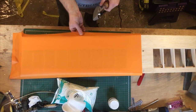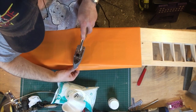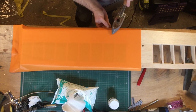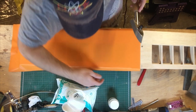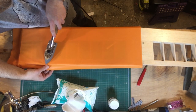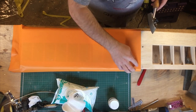So all I'm going to do now is come to the centre with a little bit of tension and tack it there. The reason we're doing the tacking is that if it isn't quite right you can actually take it off again without wasting the whole panel. And that one I'm just going to come all the way across — that's now quite well secured. Just move along, another tack, same other side, a little bit of tension, tack it in place. Half way along, quarter way along now — just another tack. And another tack at the trailing edge. I'm happy with that — what I'm going to do now is come across and tack this edge. Away where you've got the fully sheeted part underneath, I'm going to go over that whole area and make sure it's all secure. From there just lay the iron down flush and flatten the surface.